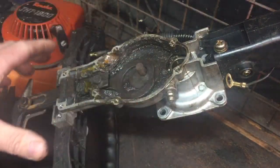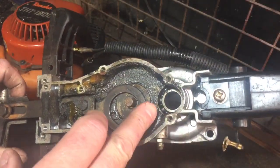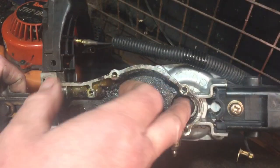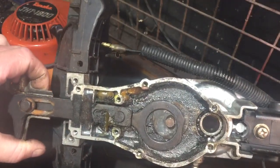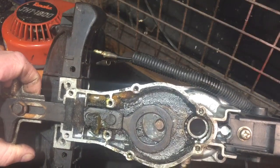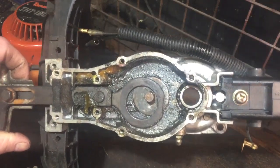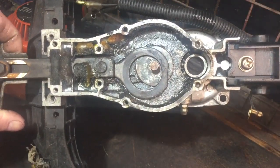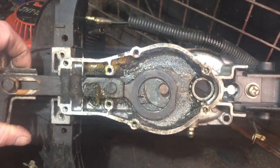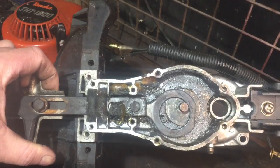And if I turn it, well, you can just quickly see there. A bit of glare on the camera today. The bearings are free-ish. Well, they're turning. I freed them off. They were seized, so they are better than they were. And I'll just hook out that old bit of grease. I've got some new grease up on the shelf, so I'll get some of that in there, and we'll see if this is a success or not. So I'll be back with you when I've just cleaned it out.